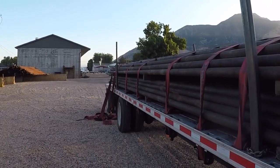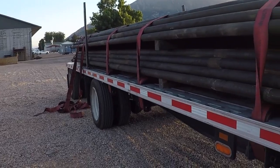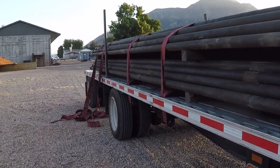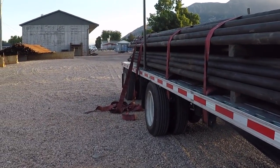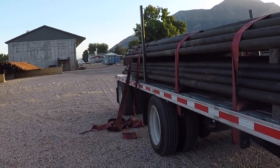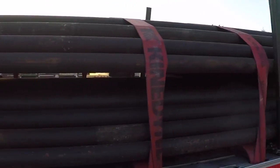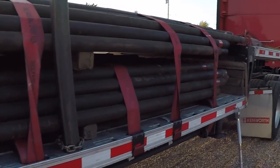As long as it's legal that's all right, but you just have to be careful. You start getting too much weight on the back of your trailer on these back tires, you'll blow valve stems. With these spread axles, you'll put flat spots in the tires if you turn too sharp with too much weight back there — all kinds of nonsense will start happening.